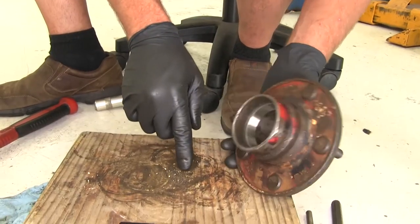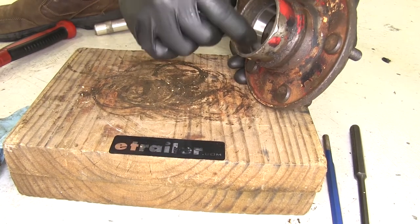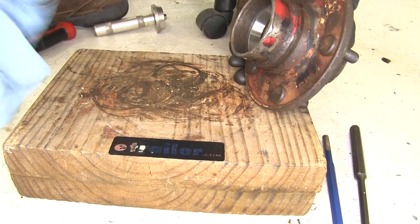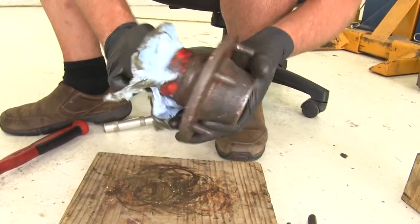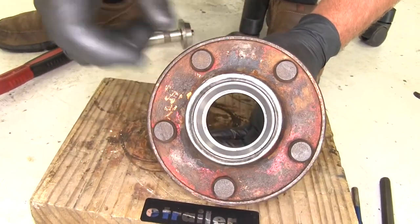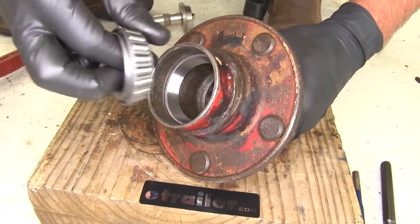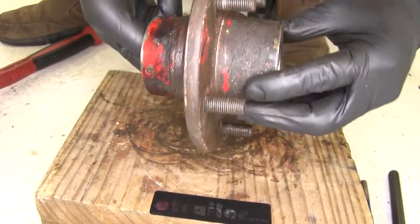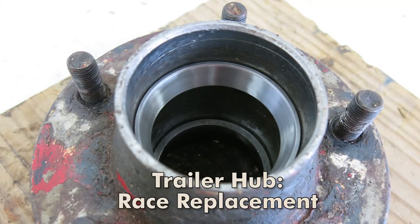As you drive your races in, you can see sometimes they pull off just a little bit of metal from the outside of the hub. So it's a really good idea at this point to make sure we get any of that out of there. What we're going to be left with is essentially a brand new hub. We've got our races right in there — our bearings are going to have an excellent spot to seat, and that'll help ensure we get maximum life out of our trailer with no failures. That completes our look at the race replacement process. You're able to replace your races in your hub rather than purchasing complete replacements.